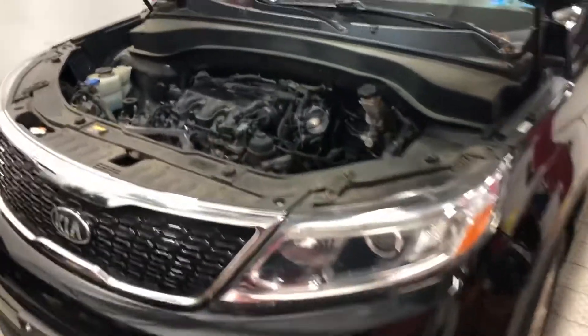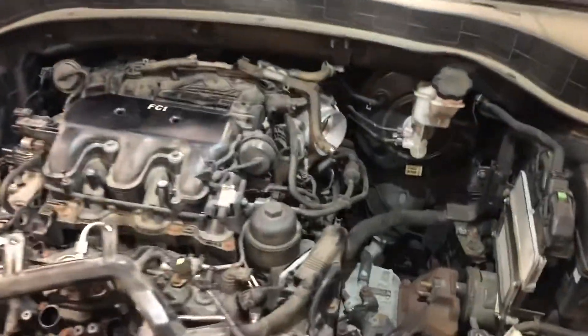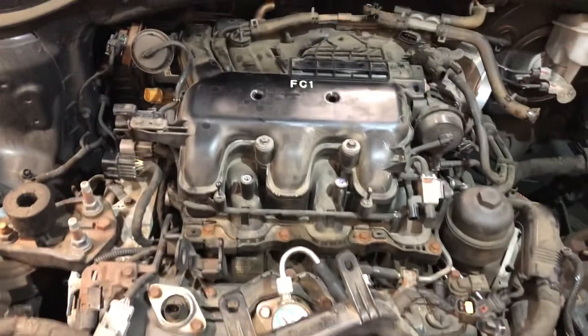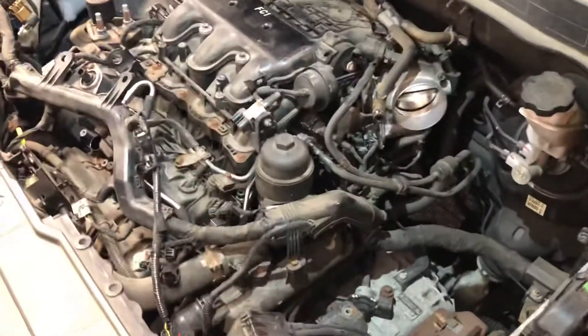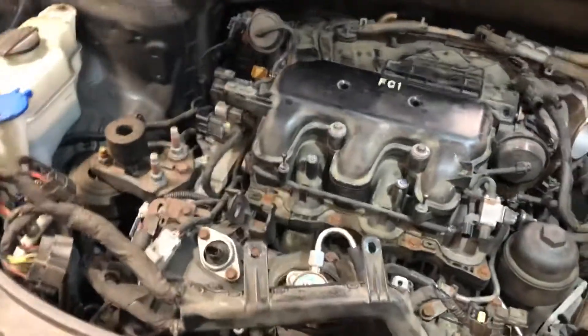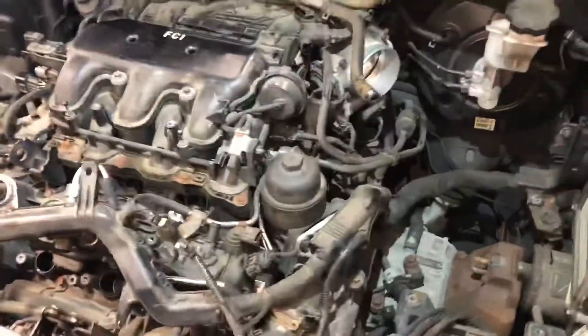Today we have a 2014 Kia Sorento. The car came in with a misfire only on cylinder 6. I did the usual swapping of coils and plugs with no change. What these have had going on lately is the GDI injectors will stick in the open position, flood the cylinder, cause low compression on that cylinder in some cases, and have been known to kill catalytic converters.